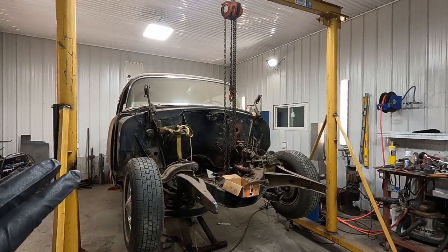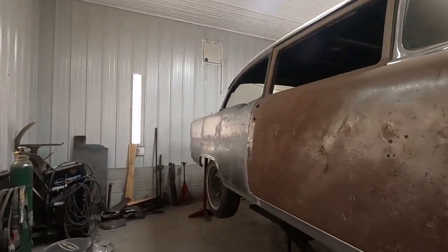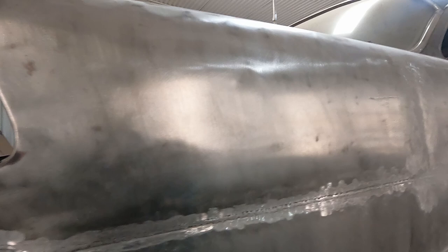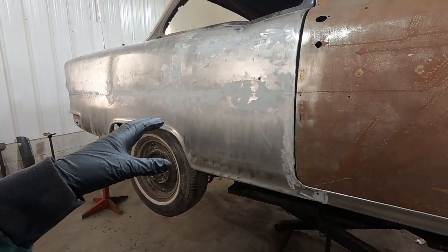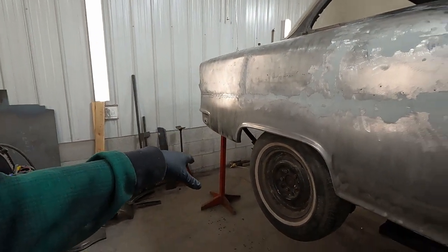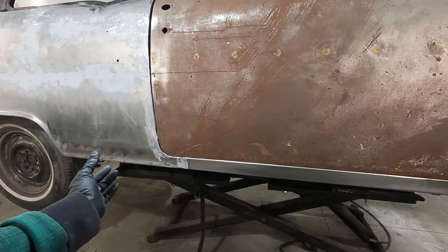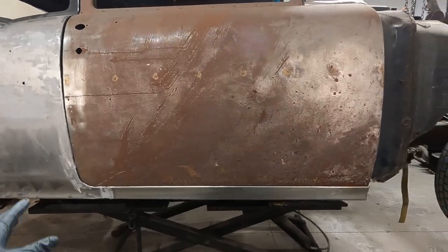I have my gantry in the front, so I'm going to pick the car from the front of the firewall with the gantry, and at the back — right in roughly the same spot where people mount rotisseries — I have these jack stands right on that rear brace. I'm going to undo all the body mounts, gather the hardware, support the front with the gantry and the back with those stands, then lower the scissor lift with the chassis, roll the chassis out, and pick the scissor lift back up to support the body from the braces and the floor. That gives me access to all the places I want and gets the chassis out from under the car.